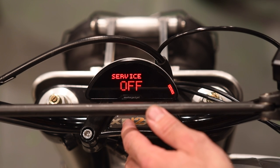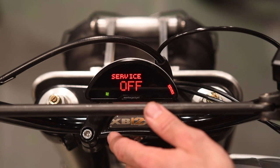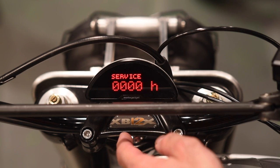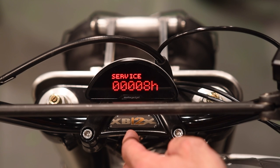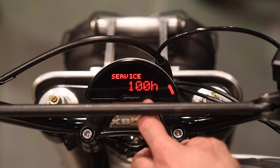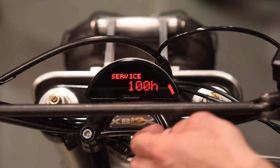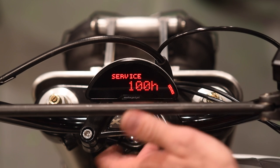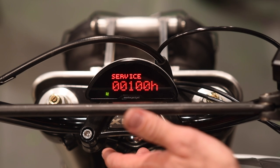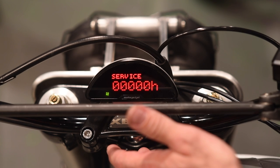Air temp is off, and service is off. Service is a feature where you set an hours limit — for example, after 100 hours of riding it will issue a service warning across the top of the gauge in the screen two section, letting you know it's time to do your oil. Personally I'm not interested in that, so I'll zero it back out. Level two navigates through the digits, and level three exits.